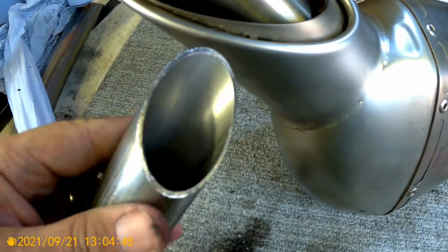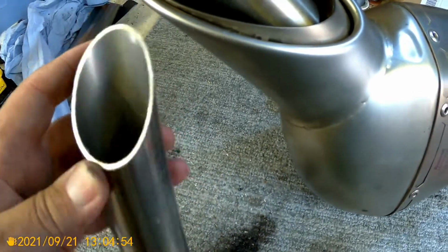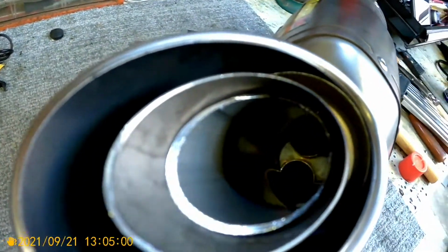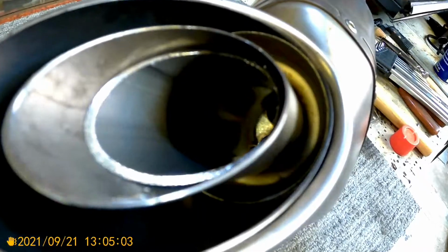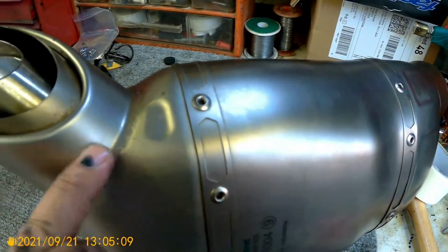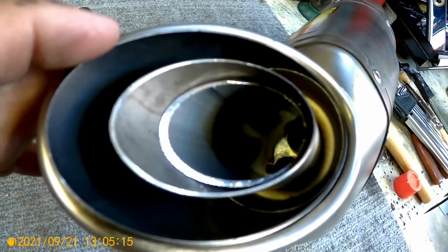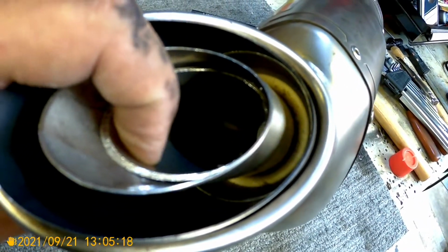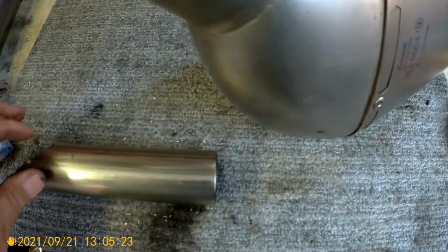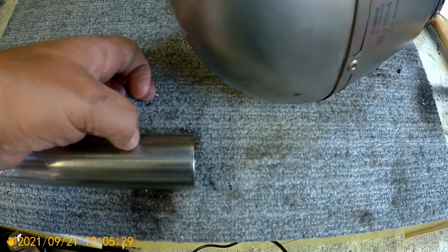Okay, so that's the first cut. And as with anything stainless steel, mind your fingers, because the burrs are sharp. Plop, and set down right against the end, so it will be restricting the gas that's coming straight in and out. Restrict the gas, restrict the noise. I will have the opportunity, once I've actually fixed this with a bolt, I then have the luxury of being able to cut down this end. Hopefully the more I cut, the louder it gets. I don't want it too loud.